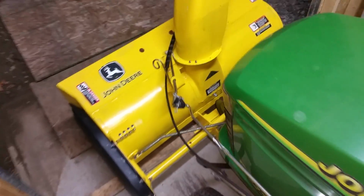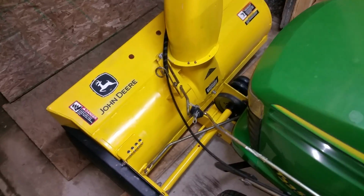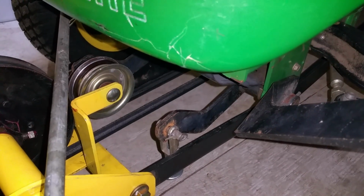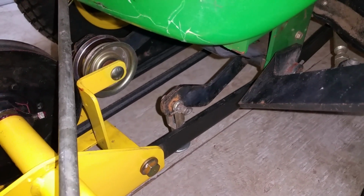when you're mounting the snowblower or the snow blade, there are lift eyes in the front here, and as you can see, it uses a 3/8-24 thread per inch bolt. I believe it's a grade 8, and the problem is that it really needs to have some spacing underneath in order to lift it up properly, and specifically for my application.